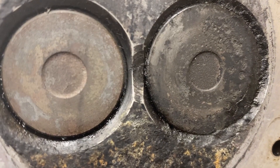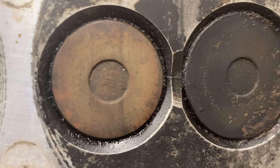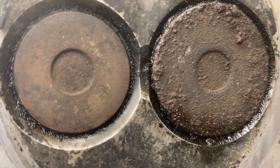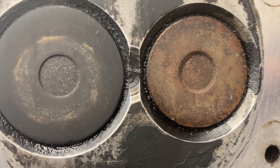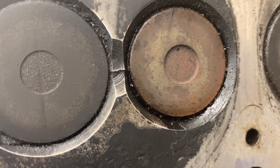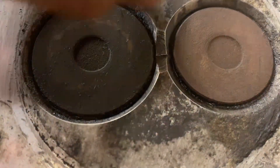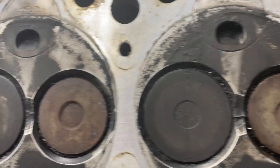Here we are on the cylinder head side, and every one of the cylinders has a crack between the valves. Volkswagen phoned it in pretty hard on this engine, so there's actually a spec for what an acceptable amount of cracking is — it's half a millimeter, which in American speak is about twenty thousandths, which is kind of a lot for a crack. I won't be able to actually measure them until I get these valves out and get some feeler gauges in there. You can see this one is the worst — it's not only cracked but raised. With my fingernail, these last two are raised a little bit; all the other ones are pretty much fine.